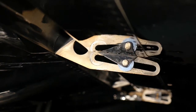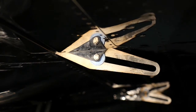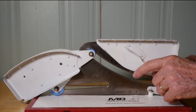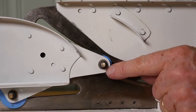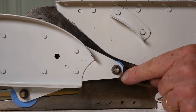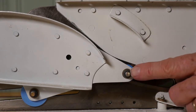The Aerostar upgrade kit gets rid of the grease and oil and the wear and contaminated lubricants can bring. This OEM roller assembly comprises a steel sleeve with a steel roller running against it and two steel thrust washers to provide axial guidance. The assembly is tied to the flap arms with AN hardware. There are five positions on each side and they are not all the same.